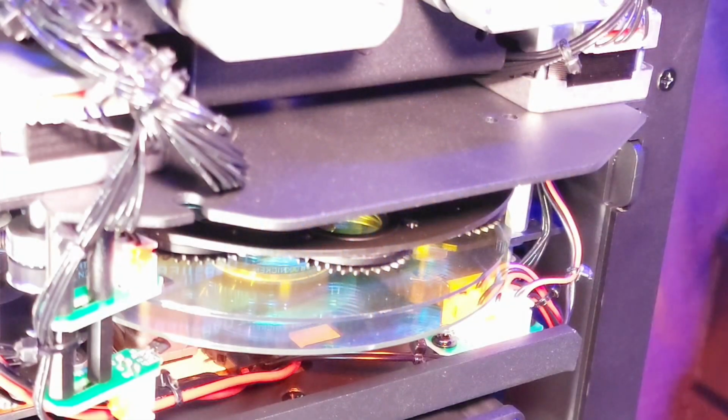You're going to, of course, replace the cover on the light fixture, and then go ahead and turn it on and make sure it is seated correctly in there. Make sure the image is bright and crisp and that you can actually see it. If you are having a problem with it, it could be that you have installed the gobo the wrong way. There's two different sides to a gobo, so if it's looking weird, try flipping the gobo over and reinstalling it and see if that fixes your problem.